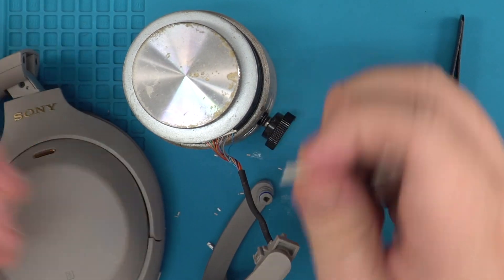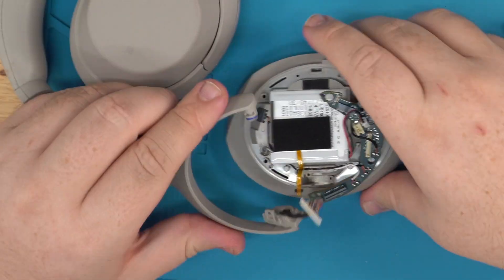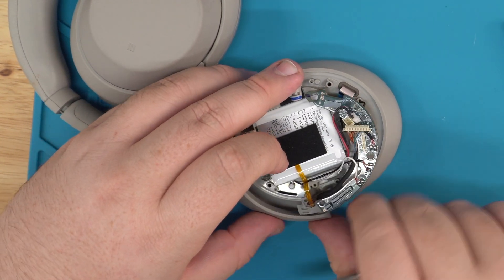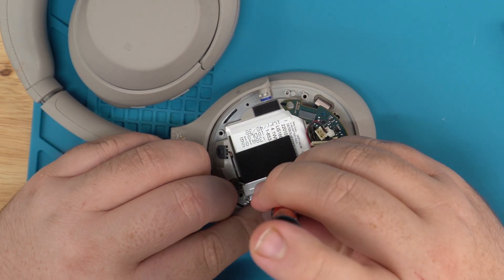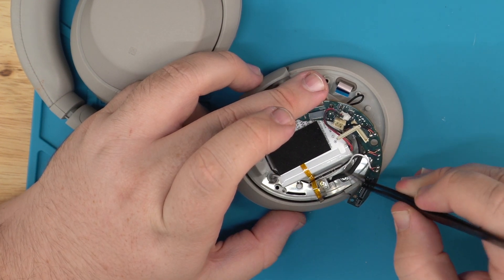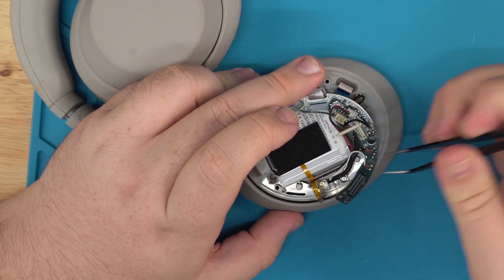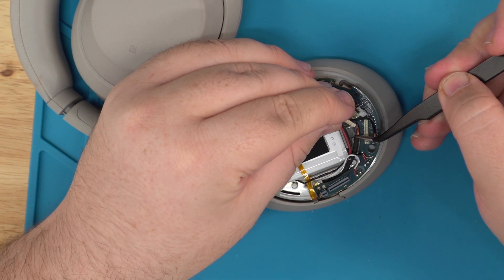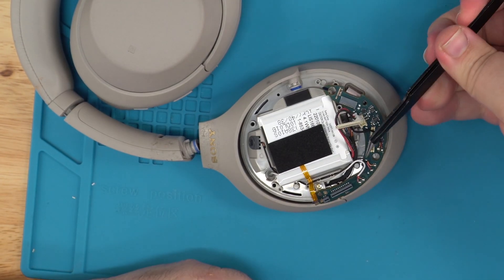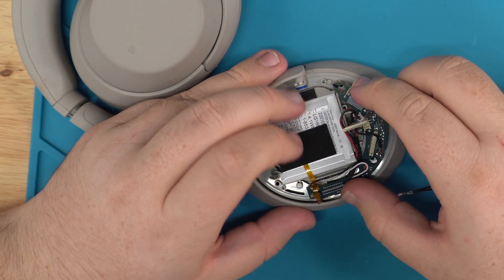Throw that old one out — that's how it should look. Everything's out. Under your vice grip — look at that, you've got your new clip in. Now here's the part where some people mess up and where I have messed up personally: getting the clip back into the main wire. First go underneath the board, nice and easy. Can't get it through with your fingers — grab tweezers. Place that first, get that screwed down, which makes the whole process easier. Right here you'll see little grooves under the wire in this area. Make sure you get your main wire pushed down into there. Don't put too much pressure, but it should fit nice and snug. Then on the top part underneath the black and red wire there's another groove — put your main wire in there too. So now it fits nice and snug. If this wire is in the way when you screw down the main board, this main board is very easy to break — it snaps like a twig. So if you put the wires underneath and screw it down, you have a chance at ruining your main board.